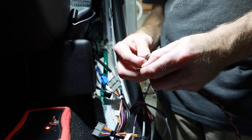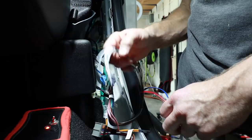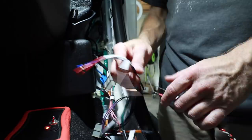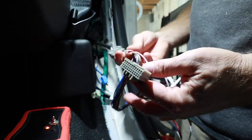Starting with our green pair — yes. There's a gray pair — two for two. Driver's side, passenger rear. So the purple, the green, the gray, and the white go exactly where we need them to go. There are also three other ones here: a red, a blue, and a brown. The brown should be center, which isn't in the car, so it's not going to make any noise. The red is subwoofer two and the blue is subwoofer one — all three of these speakers are not in the car. We don't need them, we're not going to be retaining them. This harness will work for what we want to do.